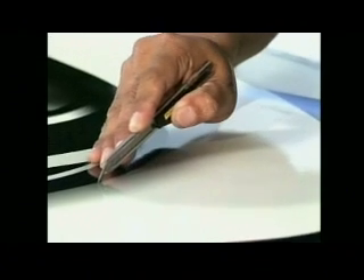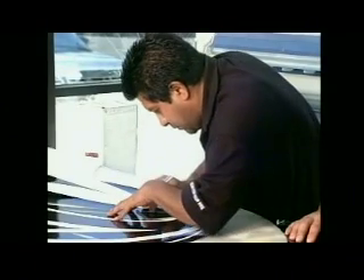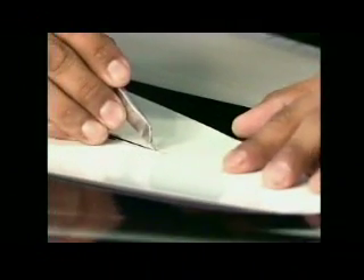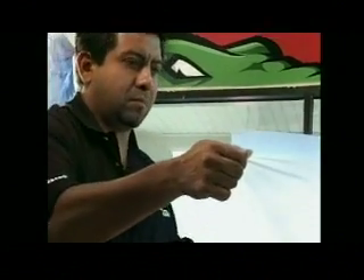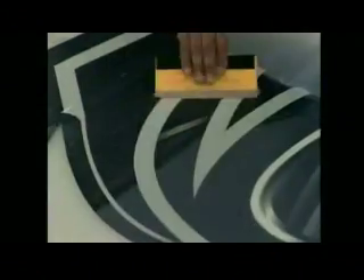What we're doing right now is taking the print and cutting out the design. We'd normally use the plotter, but the design is too big so we're cutting it out by hand. We put the design on the vinyl, laminated it, and now we're ready to cut. What determines whether we need masks is the separations from the vinyl — anytime we cut, it's sticky, so we try to put it on in one piece. Since we don't have five or six guys, we use the Digi Mask instead, and between two of us we can lay it on the vehicle. That film conforms to the vehicle, is easy to work with, and easy to remove without pulling off the decal.